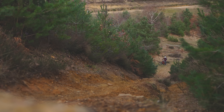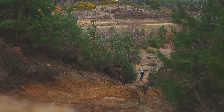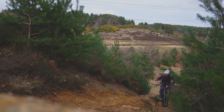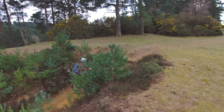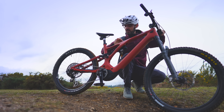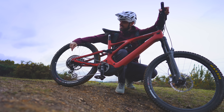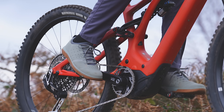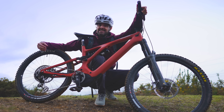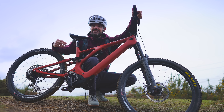The bike's in one of the lowest cogs, maybe gear 9 or 10, and I'm changing straight away in turbo. I can hear it and feel it. Going up near the top of the cassette, you can barely hear or feel it change — I know it has because it's a bit easier to pedal. What I've noticed compared to the existing or older AXS is there's less mechanical noise, less mechanical clattering through the cassette. You can still hear it — it's not super silent — but it feels like it's engaging those next cogs smoother.